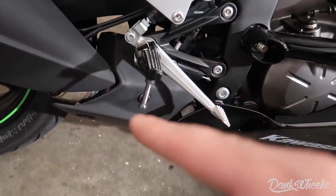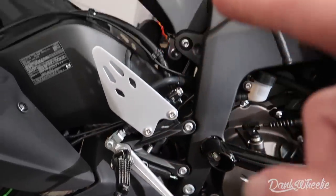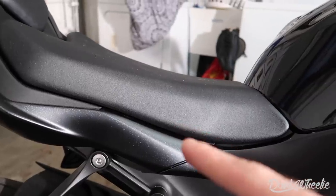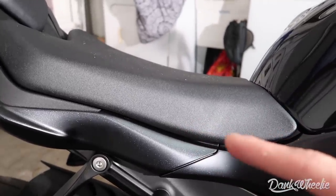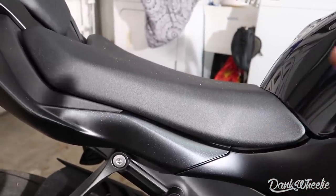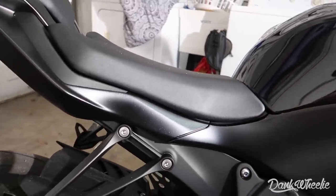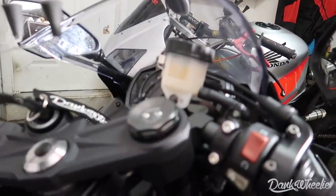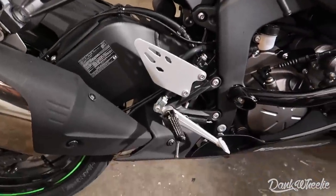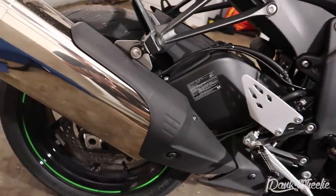One thing to keep in mind though, if you eliminate this catalytic converter box, is that there's two cables that run all the way up to your servo motor. So what you need to do if you go ahead and swap out the exhaust on these bikes is get a servo buddy, which is about 50-60 bucks, and it's basically just a simple A to B plug that tricks your motor, or tricks the brain of your bike into thinking that you have your servo motor still hooked up. So unless you do that, you're gonna have an FI light on your bike, and usually people start to panic, but realistically, to my knowledge, you can put the exhaust on and not do the servo buddy. You're just gonna have an FI light showing. So keep that in mind, guys, if you do an exhaust install.